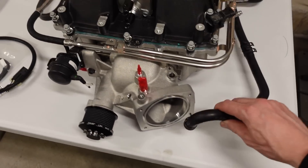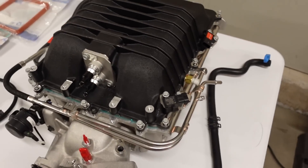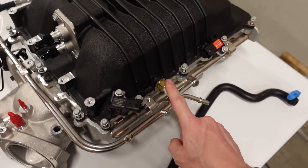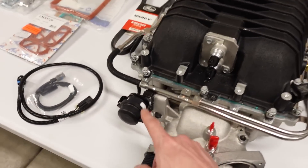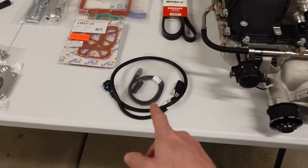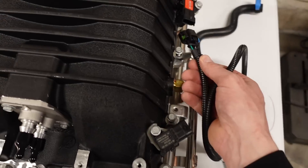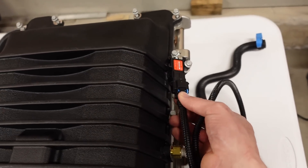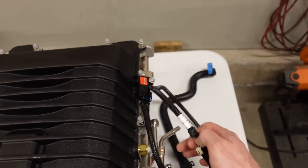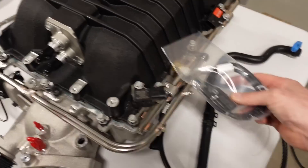We've also got what I believe is the brake booster line that goes over to the vacuum booster on the firewall. The lid comes with both MAP sensors and the inlet air temp sensor. It also comes with a little bypass valve and everything's already hooked up ready to get installed. For wiring, there are a few adapters — one goes onto the MAP sensor so you don't have to do any splicing, and it plugs into the stock truck wiring harness. There's also a pigtail for the inlet air temp sensor that'll plug right in.